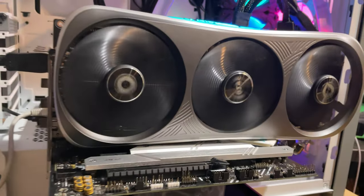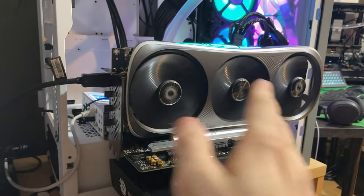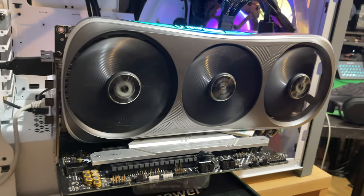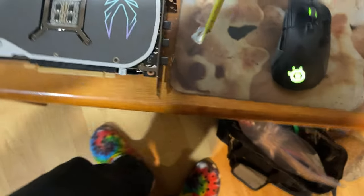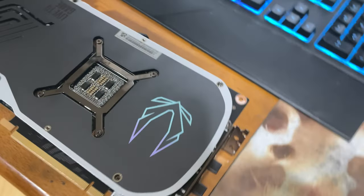We're on loop five and it has not changed — 60 Celsius, 490 watts. Three loops is enough to saturate this card. Overall, the Zotac card in its stock configuration is very, very cool. This monster is cooling 500 watts and keeping it at 60 Celsius — something we have not seen before in air cooling configurations. Just for reference, the card is about 14 inches long and about 3 inches thick.